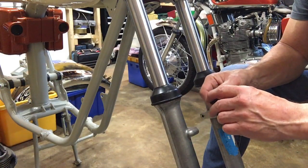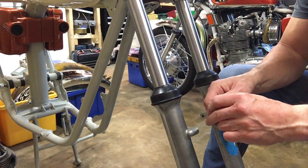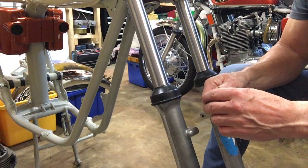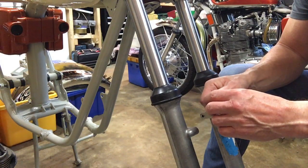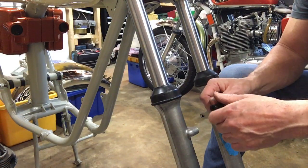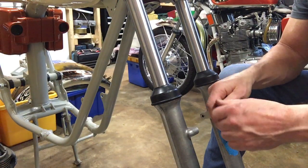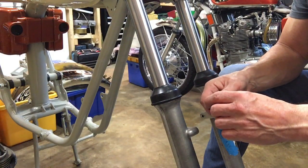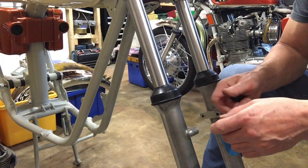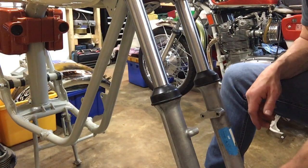Well, I've already talked about anomalies with respect to the aluminium trim strip on the tank. The pattern one was terrible. Looked good, but actually it was the wrong fit. I'll show you the rear mudguard because I bought a new pattern one, but I have got the original, which would need plating, but is in actually good nick, but it would need plating, so it's actually cheaper to buy a new one. But the pattern one isn't quite the same diameter. It'll fit, you know, with a bit of jiggery pokery. Also hasn't got the front bracket. But anyway, I'll show you that in a moment. I digress. Let's get on with this front mudguard first.